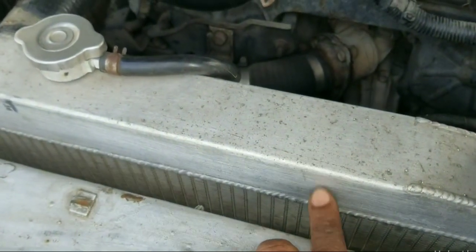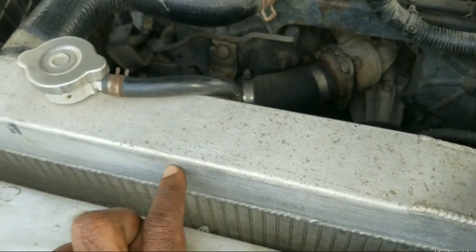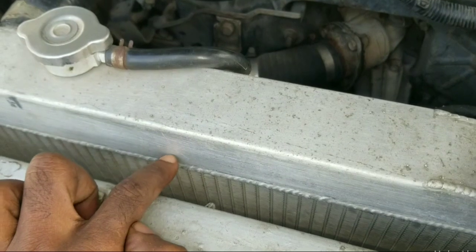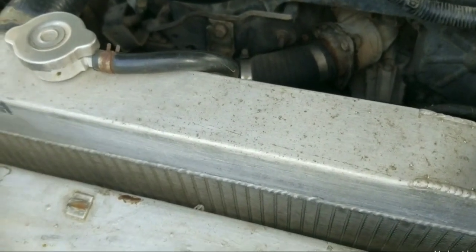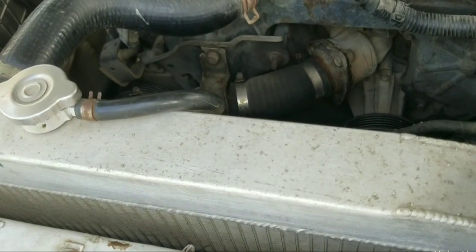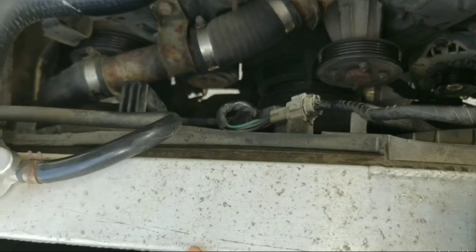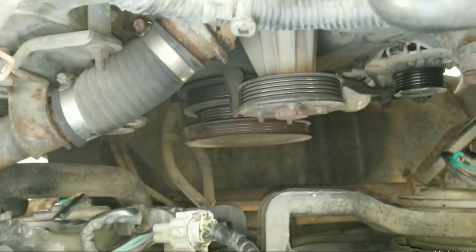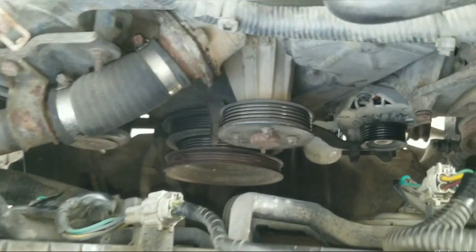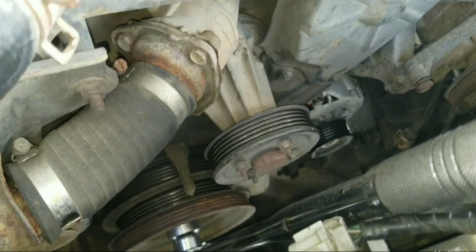Big plus also for the aluminum radiator. The plastic ones become deteriorated — sometimes they leak where the aluminum core meets the plastic. You might want to invest in one of these aluminum radiators; it's approximately $200 and you can find it online. In the video description I'll have links to all this.